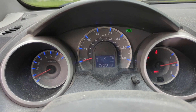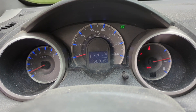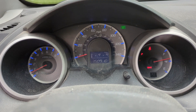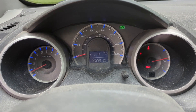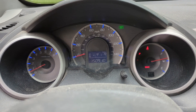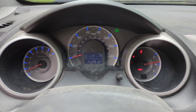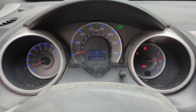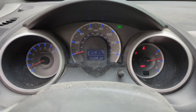I got into the habit of taking shortcuts, which was a mistake, but the new unit is in. I'll put a picture of which one it is, but it's from a 2013 Honda Fit going into a 2010 Honda Fit. When I put it all back together and turned it on — no power steering light. I just drove it around the block — no power steering light, power steering works. So it is possible to use a different EPS module from different years, as long as it's the same generation — plug and play.